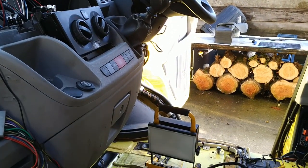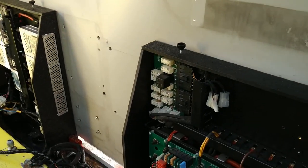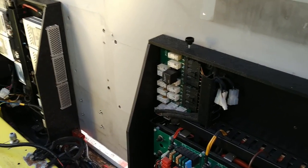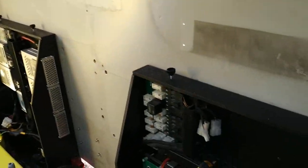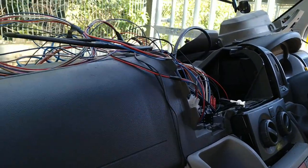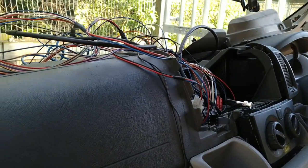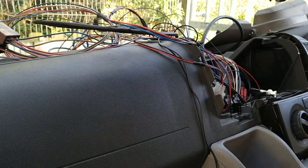There's a heck of a lot of cabling that needs to come out on that side. I'm not quite sure how the blue lights and headlights are wired up in this van — the chances are they spliced into the headlight cabling somewhere, and obviously that needs to be reconnected in order to render this bit redundant. There's still a lot of cabling sticking out from the remnants of the dashboard that needs to be tracked down so that a standard radio could be fitted.